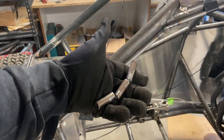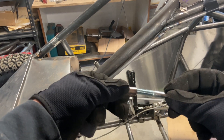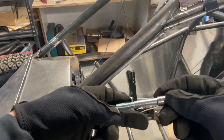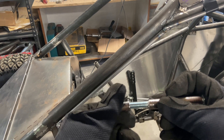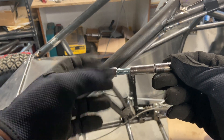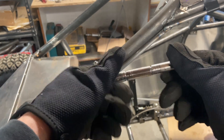We've got our three pieces cut out. The first two I just drilled out to 3/8 for the 3/8 bolt so they just slide on. The third one is tapped so that it threads in. So now we have a hinge set up — Neato Cheeto. The door is the light part so it gets two welds, and the frame is the strong part so it just gets one.